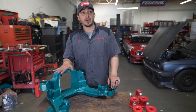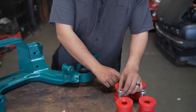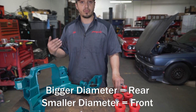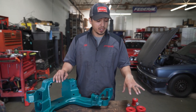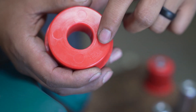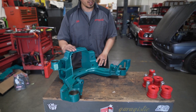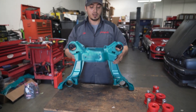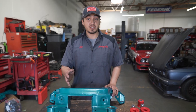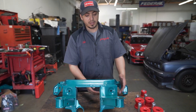One of the things you're gonna notice when you have your subframe out is the different diameter on the inside of the races — ours match the factory ones. The bigger diameter one is gonna go on the rear of the subframe, and the smaller diameter goes on the front. As for the bushings, they're all labeled — they all have lower rear or lower front marked on them, so you won't get mixed up. I recommend positioning the subframe how it actually goes in the car, so you know this is the front, this is the rear, this is the top, and this is the bottom.